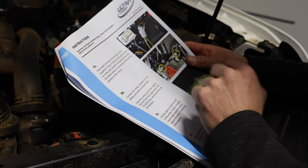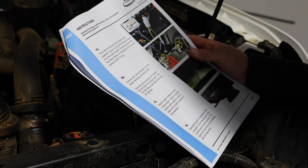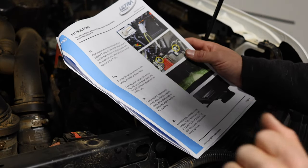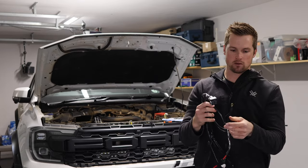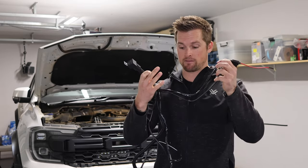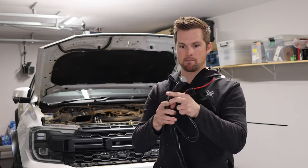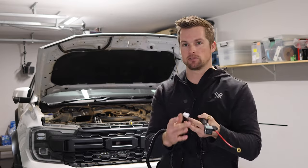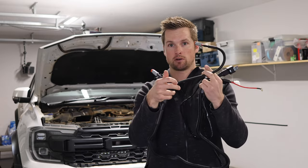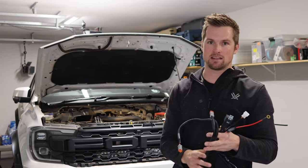We're on to our last page. Now we have to connect the wiring harness to the battery terminals over there, and then we're going to feed the harness across the engine bay and plug in our light bars to do a test before we assemble the hood and the grill. We have to connect these to the battery — that's what we're going to be doing last, because as soon as we connect these, obviously everything is live. This we are just going to mount somewhere near the battery on an M8 bolt. This is going to plug into that little T section we did just now.